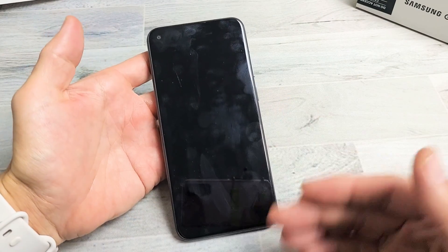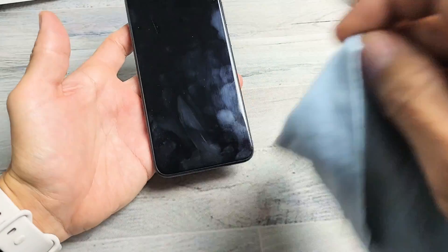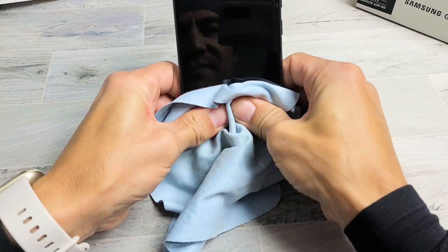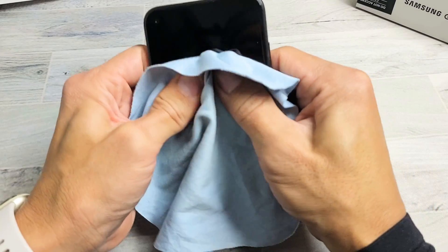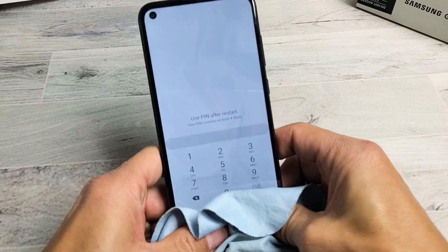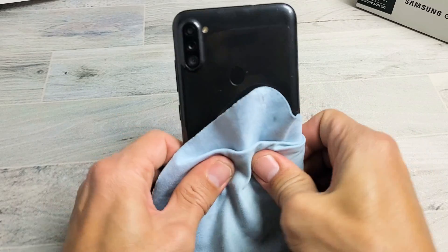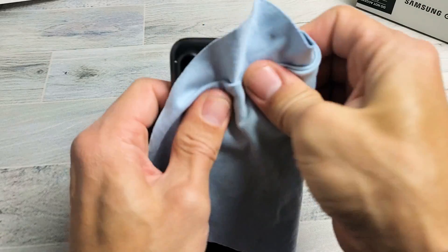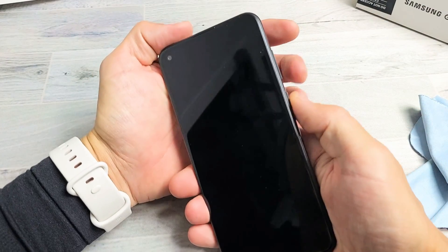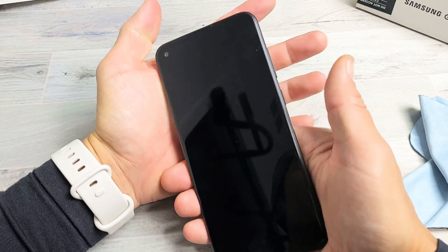If you're still down, the next step is what I call the massage method. We're going to massage the screen and the back. You can grab a cloth or a paper towel if you don't want to dirty up your screen. Hold the phone and use your two thumbs to press the back and the front at the same time. Just massage it — keep going. Sometimes you'll get white lines or flashes, or the screen will turn on. Sometimes you can hear a little click and all of a sudden your screen's back on. FYI, I am not responsible if anything happens to your phone. Keep pressing all over, even around the lens. Turn it over and see if it's still black, then force restart it: press and hold the volume down and power button, do not let go until you see the Samsung logo appear.